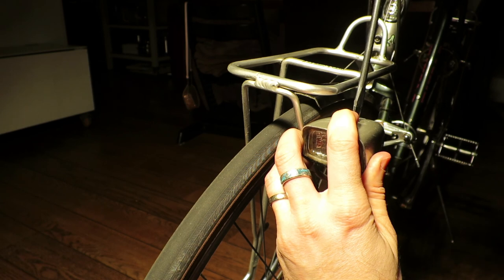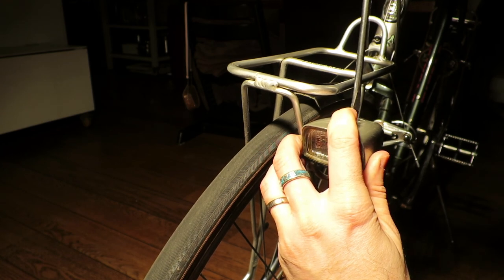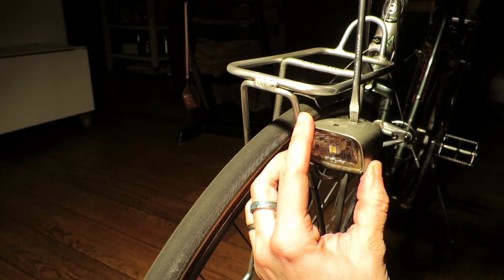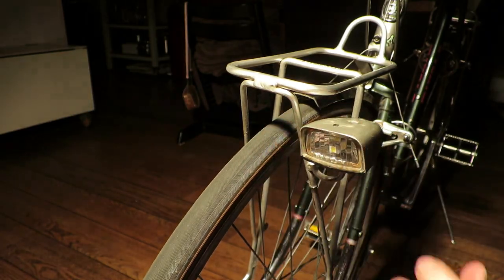One of the most obvious downsides of replacing bicycle light bulbs with an LED is that you'll lose that characteristic yellow light. You won't notice it for the rear since the encasing is red plastic, but you will for the front. But what you'll get in return is four times as much light that lasts you 10 times as long.